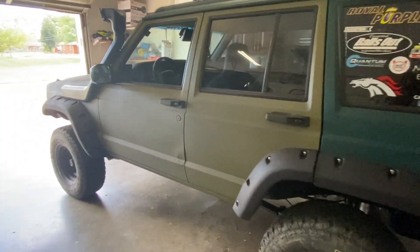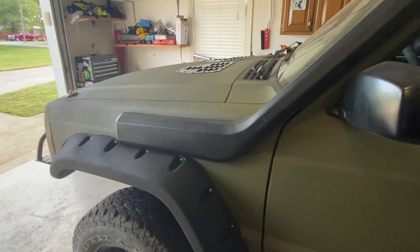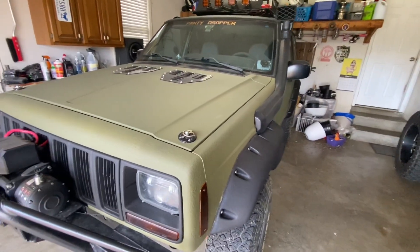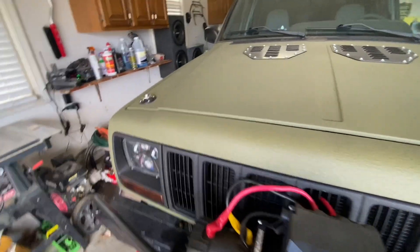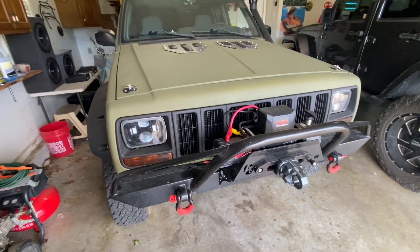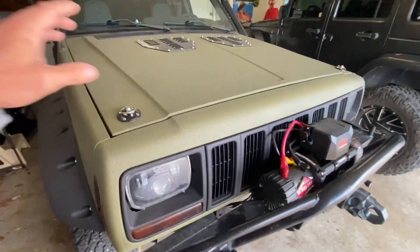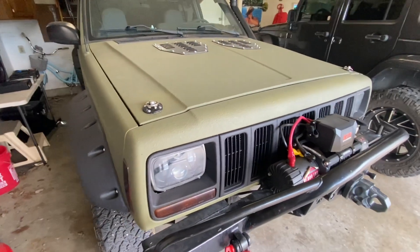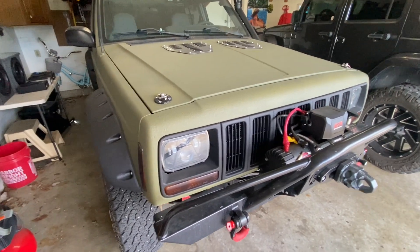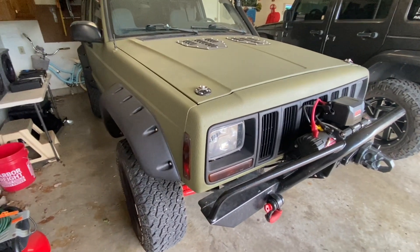Since it's cold today I'm going to do this in the garage. Mountain Vista got their TK shift linkage — works great. Talked to Brandon up there, these guys are super awesome and informative. They have the metal battery tray. This is the plastic tray that comes in the XJs — they get old, they get brittle. This is a '98, so it's 20-some years old. It gets brittle especially when you off-road it, breaks free, and you can actually ground your battery out on the hood. So they sent me the battery tray, I'm going to take it apart, put the new one in, check it for fitment, and follow up. If it's anything like the TK linkage, it's going to be amazing.